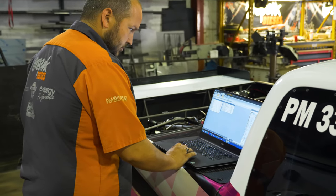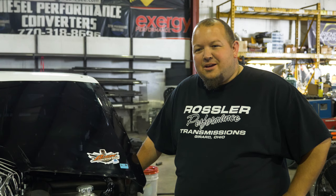But we're going to go back to the stator that we had last year since we got the fluid really hot. With the tighter stator, we can get it spooled, but it does create a lot more heat in the transmission, and we really fought keeping heat out of it. Hopefully we can get a few more test hits in tomorrow night before we go to Rocky Top, just so we have a better handle on this new gear ratio and all that good stuff. But just doing a lot of little knick-knack stuff.